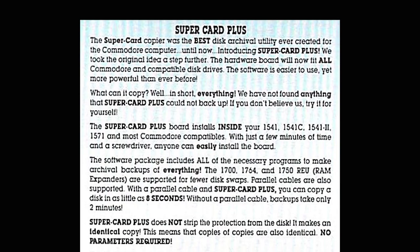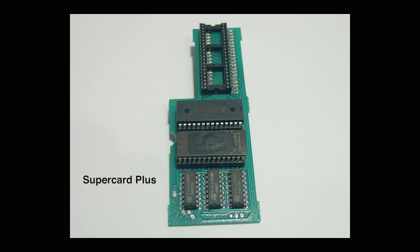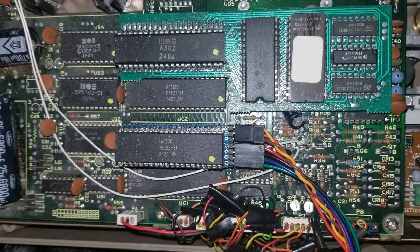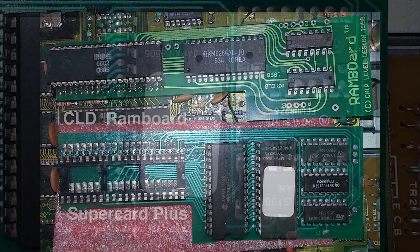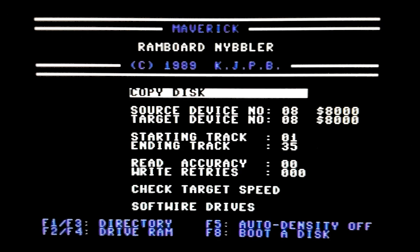In the summer of 1989, he introduced the SuperCard Plus. The SuperCard Plus maps its 8K RAM on the 1541 at memory location $6000, while the RAM board was at $8000. The SuperCard also had a set of ROMs onboard with extra routines for the copiers and tools on the SuperCard software. It also had an identify card — a small ROM placed in the 8K SRAM on the SuperCard. This included a collection of helper code so copy programs didn't have to upload as much — a faster, smaller program. And yes, the SuperCard Plus board did work with Maverick software.